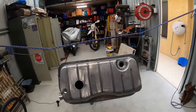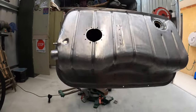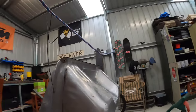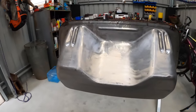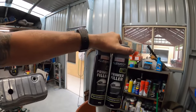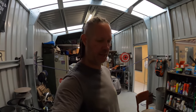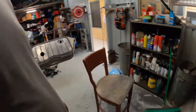This is what I've come up with in the spray booth — I'll just tie some rope from one side of the shed to the other and hang the tank up there. Hopefully I'll be able to get all the way around it with relative ease. One thing I'm going to do — a couple of you guys suggested it — is heat up the primer by sitting the cans in a bucket of fairly warm water and shaking them regularly. Apparently when it's a bit warmer the paint spreads thinner and better. I'll give that a crack.